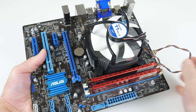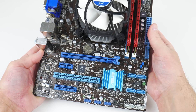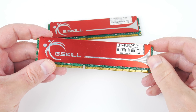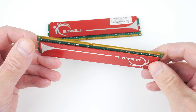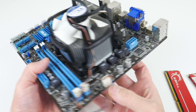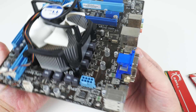So we have the patched drivers, we've got the graphics card, and now we need to put together a Windows XP system. I'm going with something fairly modern — it is the Intel Core i7-3770 on an ASUS motherboard, the P8-H77MLE. We have four gigabytes of RAM, two 2-gigabyte memory modules with an XMP profile running at 1600 megahertz. We have PCI Express 16x, 4x, and 1x, as well as a PCI slot, two SATA 3 ports, and four SATA 2 ports.